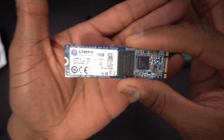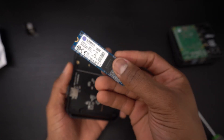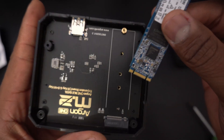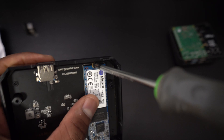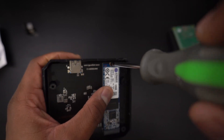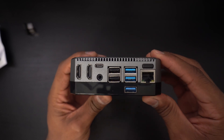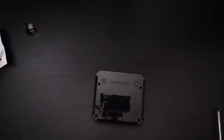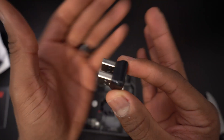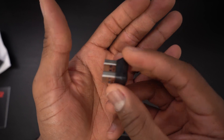Before you attach the bottom you have to install your M.2 drive and insert your SD card, because once the bottom is attached you will not have access to your SD card slot. Once everything is connected and the bottom plate is secured, the last thing you need to do is connect the USB 3 bridge. The USB 3 bridge connects the M.2 drive to the Raspberry Pi 4, so you will lose a USB 3 port — but you can connect a USB 3 hub for more USB ports.